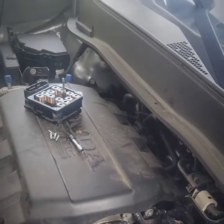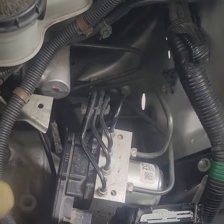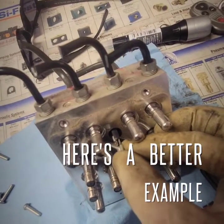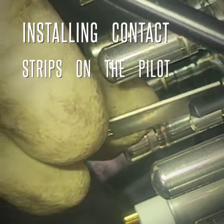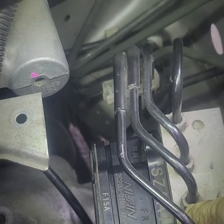There's enough room to sneak the bolts out and remove it. The only tip I can give you is to take these strips out and put them in the ABS unit first. You want to put them in this channel and press them — that's when you know they're set. Position them outwards and they'll just kind of snap in firmly. I messed up the first time because I didn't do it that way — I had some codes, took it apart, and figured out my issue. If this thing doesn't sit on here pretty nice and easy, then you've got a problem.